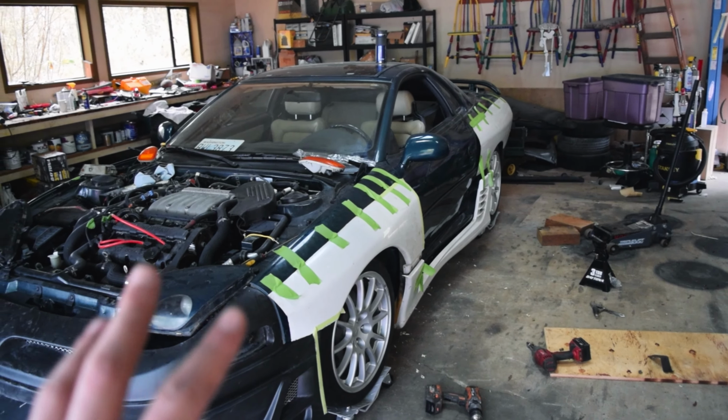Then we're going to go ahead and do the same on the back and the same with the fenders themselves, so that way they are perfectly ready to just have someone come in and weld them on. So far today we've got the side skirt brackets mounted underneath, we've got the fenders trimmed out, and now we have to just get that ground up and ready for the mating surface. So that's our last step before we could actually start to weld everything on. So let's go ahead and get that knocked out now. Here we go.